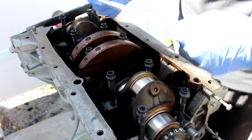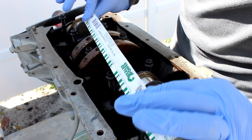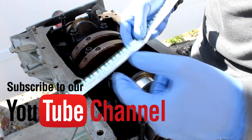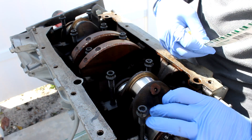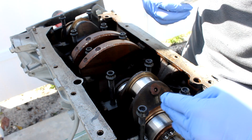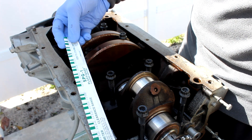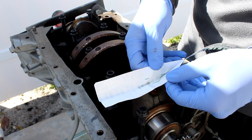Welcome to DNA's Garage. Today I'm going to be going over plastic gauging. Plastic gauging has become pretty famous during engine building. Pretty much the whole point of plastic gauging is that it allows you to measure spots where otherwise you couldn't measure — for example, the oil clearance in the bearings. You apply a little piece of plastic gauge, torque it down to specs, and then you can know how much oil clearance you have and whether you have the correct bearings or need to make adjustments. This is the normal plastic gauge, and inside you have a little string.